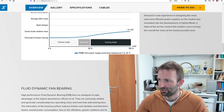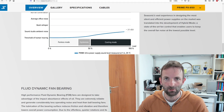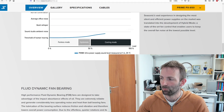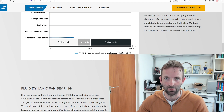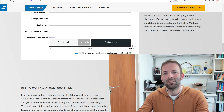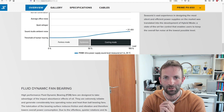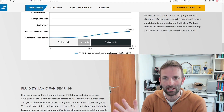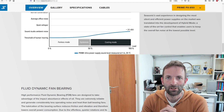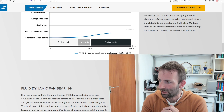It just doesn't quite have the power for my new CPU, so this one is inaudible — excellent. I went with one of these semi-passive Seasonics because they are fanless until 35–40 percent load. I've got the 650-watt version, so I figured at one third that's still more than 200 watts, which is more than I'm using when I'm just sitting at the screen doing nothing. So no noise at idle, and a bit noisy when gaming — that's fine.